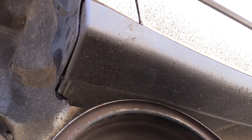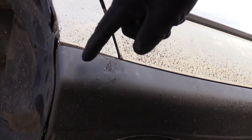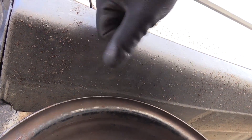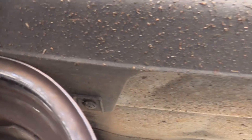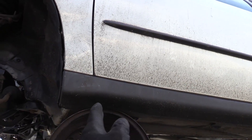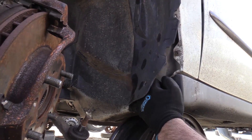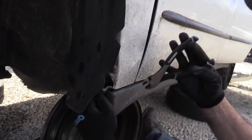On this vehicle we're presented with something of a dilemma. This rocker cover here needs to be removed to access the lower fasteners to the fender. Unfortunately the vehicle is being supported right underneath this plastic piece, so we're not going to be able to remove it the way you normally would. Normally you would remove the plastic clips going all the way down, then push the entire piece back or forwards and it should unclip from the body. What we're going to do is pull this piece down and cut some access with side cutters.